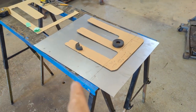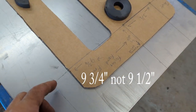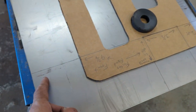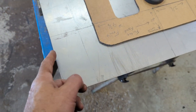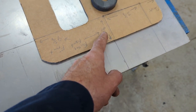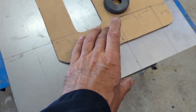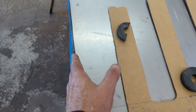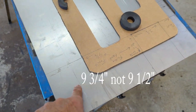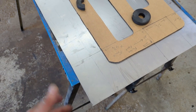Now I've got my wife's template and I've put some reference lines on the new panel. It's nine and a half inches to the drain hole. The first bolt in the drain hole — the drain hole is three and a half inches — that's the actual factory edge underneath where your feet go. This comes up within an eighth of an inch of the pinch weld, and that bolt is five and seven-eighths out from that drain hole. These measurements are right off the factory — nine and a half inches, five and seven-eighths, and three and a half for the drain hole.